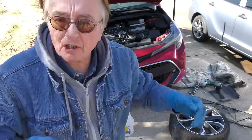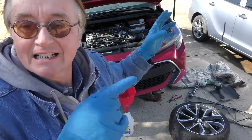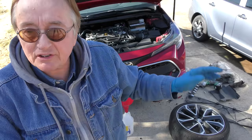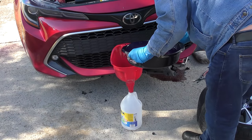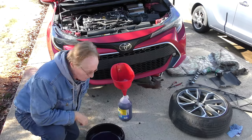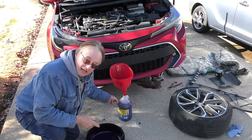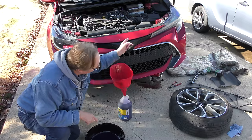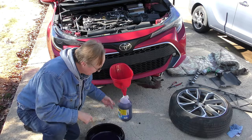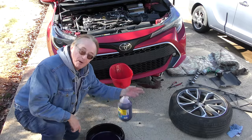In order to fill it correctly by measuring it — since there's no dipstick — there's a complex system you have to go through, but here's the easiest thing: get what you have, pour it into a container, and you'll see exactly what came out. Now what you can do is pour this out, pour your new fluid in up to that mark and you'll have the same amount. I've already marked this and it's 4.25 liters, so we'll put 4.25 liters back in. If you don't have anything marked, empty it out, clean it, fill it up to that ring, and then pump that amount back in.